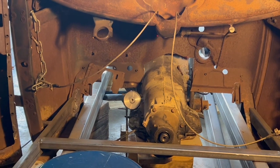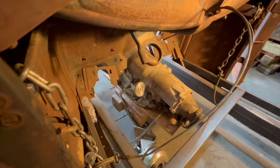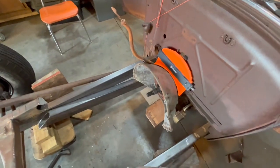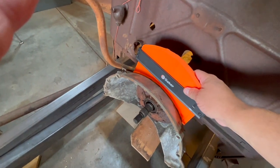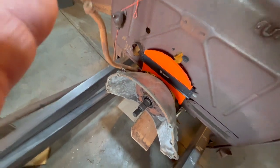Keep in mind you've got to put a steering wheel in there, a gas pedal, and you need room for your shifting. This is an ST400 transmission, which is a Buick — it's the same thing as a Turbo 400 but with a different, rounder bell housing, because I'm putting a 401 Nailhead in here. Another cool tool is a contour gauge — my wife got me one for Christmas. It makes it easy to cut holes when you need it and it's pretty cheap.